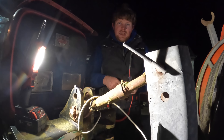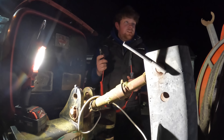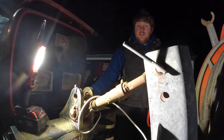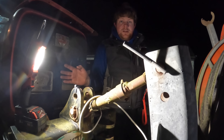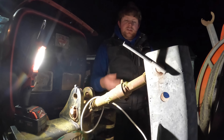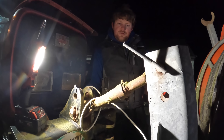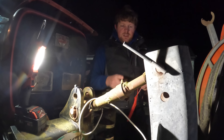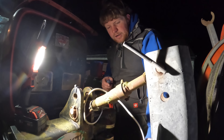Cab is cleaned out, nothing too exciting. Moving on to the headlights now. Lights turned on, I have my side markers but nothing else. The power that goes to the front was taken off all the headlights because we don't need them with the front railer on — these are absolutely pathetic with the railer on. The power goes straight into cables which goes out, so my side markers are actually powered off the headlights on the dip circuit, which means I should have power coming through.